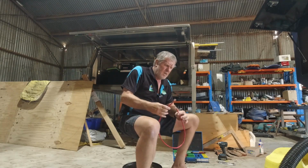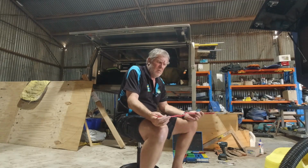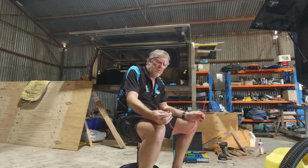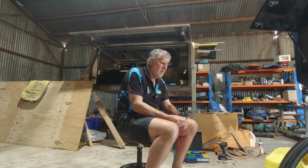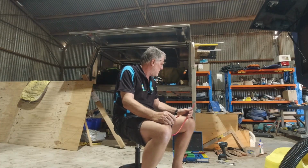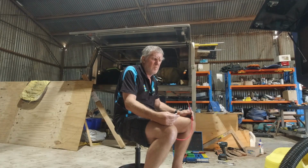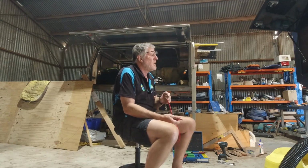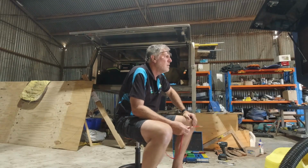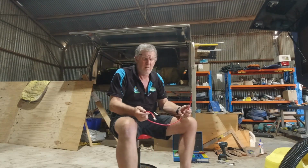This is a 6 B&S cable. Was twin core, I stripped it out. Funny thing is, if it's on its own like this, it has a higher amperage rating than if it's twin core. If it's twinned together, it's a lesser amperage rating. So I'll tend to split it a bit. So I got this going from the charger to the battery, and then from the charger to the front, I'll use 4 B&S. It's a bit thicker. It's a 40 amp DC-DC charger, so needs thicker cabling.